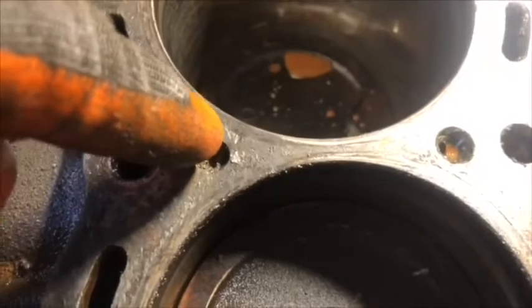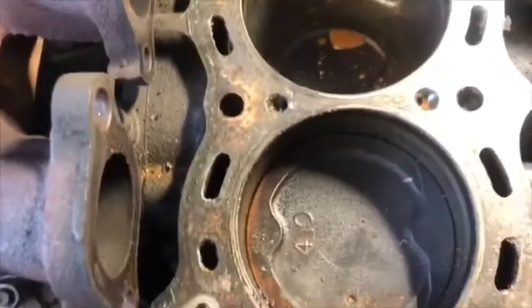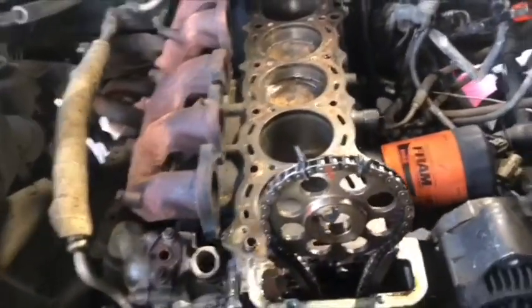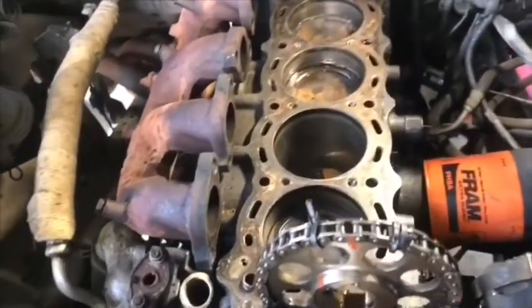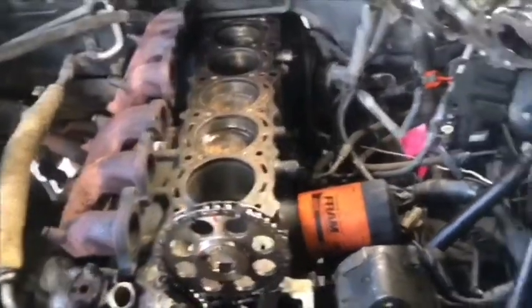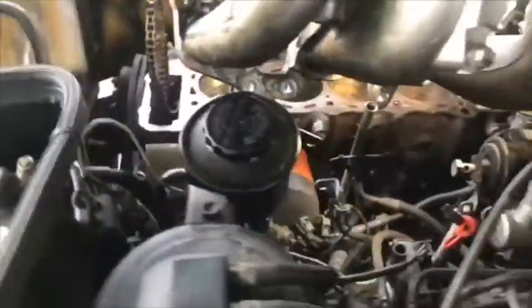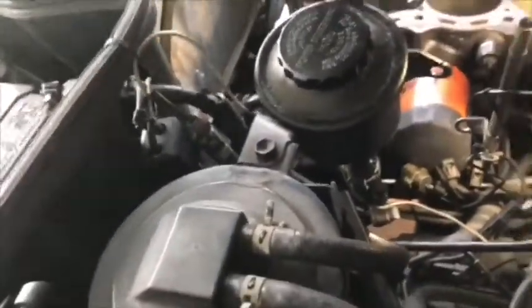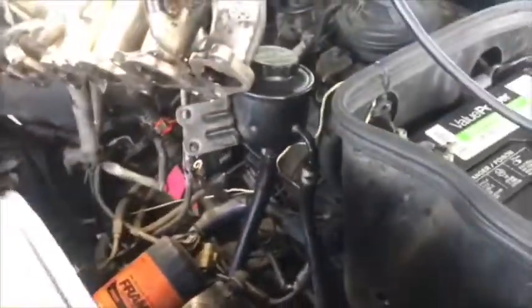Okay, we can check the engine block. We also see the black part there, where it has blown. What we now have to do is clean the head and cylinder block very well with some paper to put a new gasket on the engine. I already bought the gasket, I have it here.